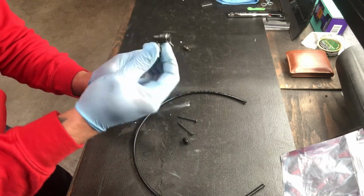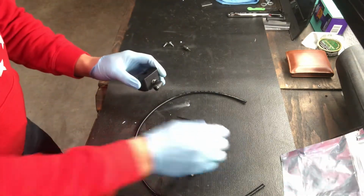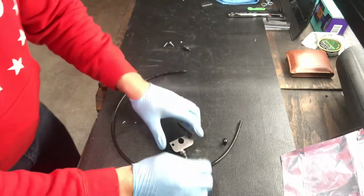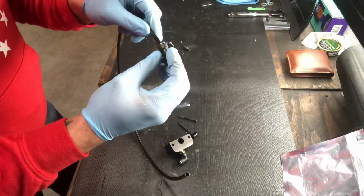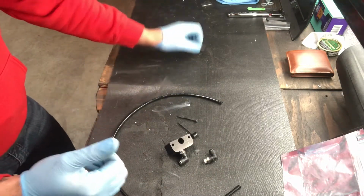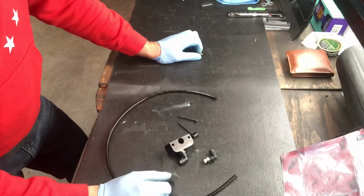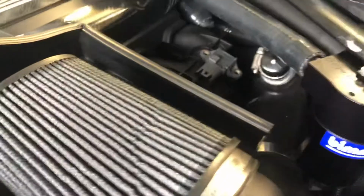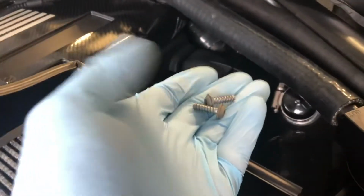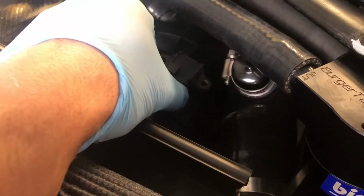This one goes on your blow-off valve side. So, nipple to block off your manifold vacuum line, and then a new hard vacuum line. These are press fittings. We're gonna pull off the map sensor, which I believe is a T25 or T20 Torx, unplug it and go from there. I pulled mine apart off camera. You just unplug your map sensor right here, and then you have the two screws, one on either side, and then you just pull this out until it releases.